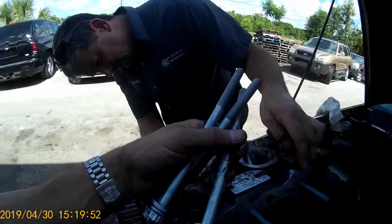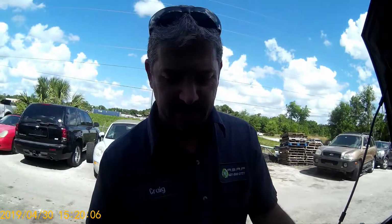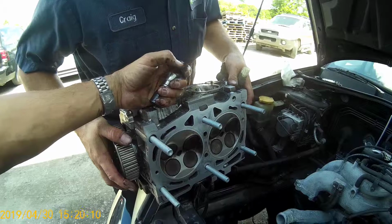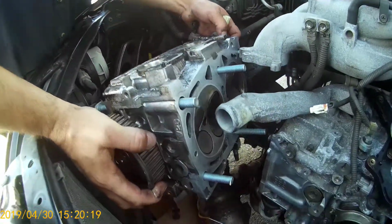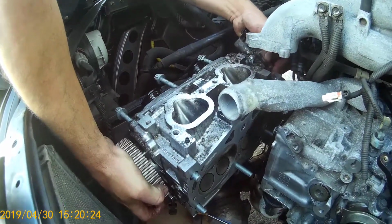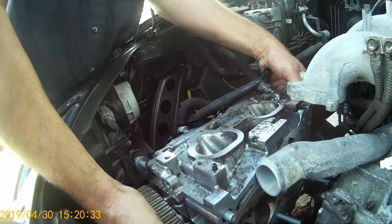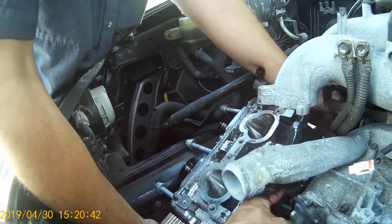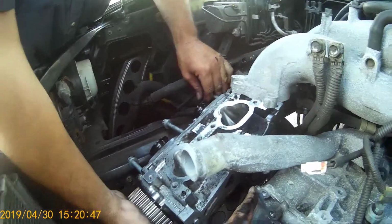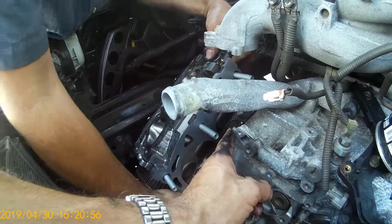Okay, so the bolts go in first. Bolts go in first when you're doing it in the car, because you're never going to be able to get them in unless you drill holes in your frame. You don't want to drill holes in the frame. Makes it a little bit more of a challenge, kind of fumbling with the head and the bolts hanging out there. When you got helpers, nothing is impossible. Alright, so head's going in. You're going to have to position that head gasket better. A little tricky with the bolts. On the front dowel. There we go.